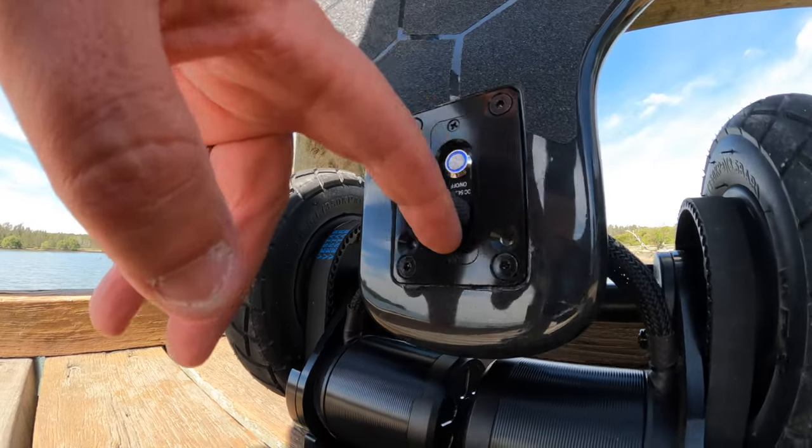I like the ESC they're using - I like the fact that it's really basic, it's punchy, it's responsive, it's smooth, it's reliable, it's dependable. I really like the tyres they're using - I haven't seen these tyres before. And I like the fact they are using TKP trucks. One opportunity: make the hangers CNC milled as well - the base plate already is. CNC-ing those hangers will give riders more confidence and adds a premiumness to the product. Now something I didn't talk about while riding is the location of the power button and charge port. It's in a nice machined-out recess area. The problem is if you get caught in any rain, that recess will almost act like a sink and hold water, which will go straight into that charge port or power button circuitry. If I was riding this and there was any chance of rain, I would put some duct tape over it to keep the moisture out.